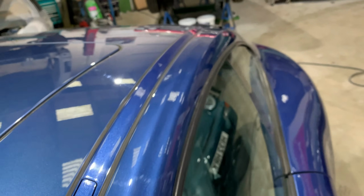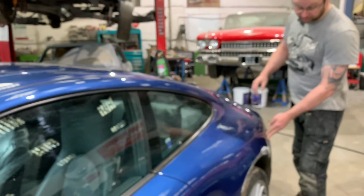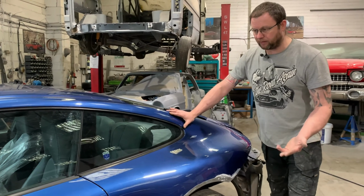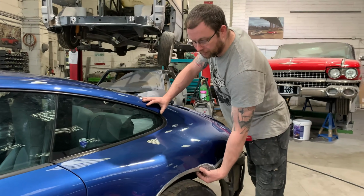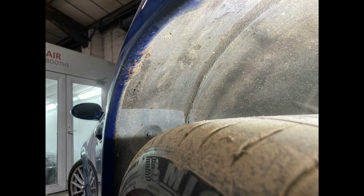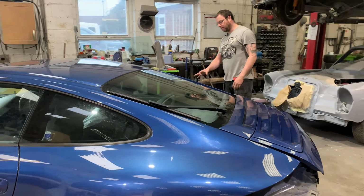We've not really started on this, but out of curiosity, I'll ground back the wheel arches to see what we're dealing with here. I'll overlay, as usual, a bit of footage from up inside this arch lip. The arch lip tucks right back up inside the car. Now, whoever did the previous repair, they've not got paint up there. So you'll be able to see in the clips I overlay that we've just got sharp, jagged lacquer where it's all just delaminated away and peeling away. And we've got corrosion sitting in there again. So we'll go over and redo that, cut the inner lip out, repair the inner lip.